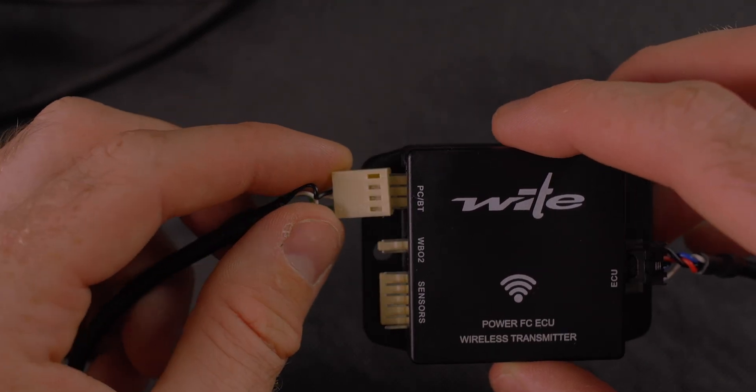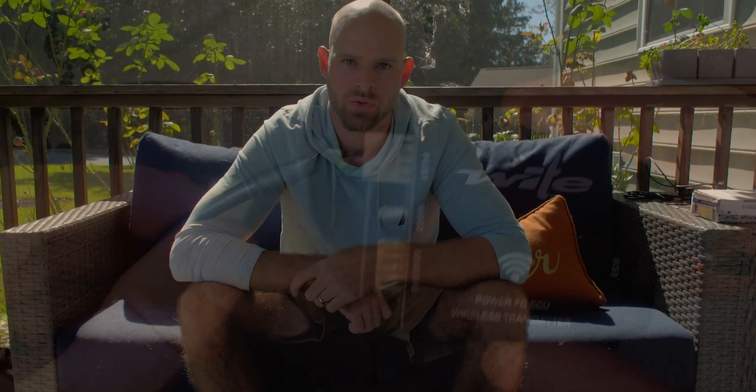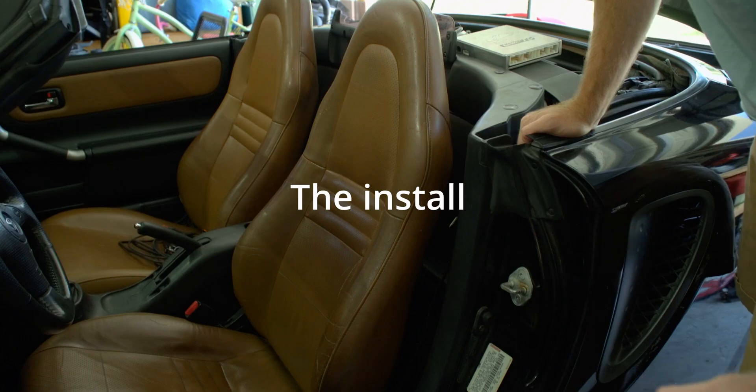Now that's not to say right off the bat that by giving it wireless access you can do anything with it, but realistically you can. What they did was they wrote an API — they created an API that allows you to talk to another app on your smartphone or tablet called RealDash. With RealDash, you're able to pull and parse the information being pulled from this, from your Apexi PFC, and display it on your smartphone or tablet.